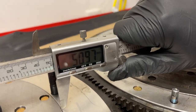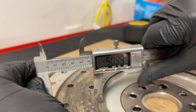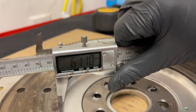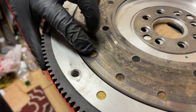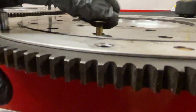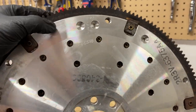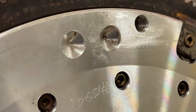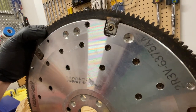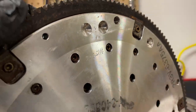Something that might surprise you: a twin disc clutch actually uses a smaller contact area because there are two discs. On the flywheel the usable surface area is about 50 millimeters, and on the Terminator it goes up to about 61 millimeters — a larger area. The twin disc brings it in closer to center, which is better for rotational mass. On the stock Terminator we noticed a rivet that had come loose, causing bowing — aluminum isn't the ideal flywheel material, which is why there's a hardened steel section. The McLeod flywheel does not come pre-balanced; that's highly recommended by McLeod.